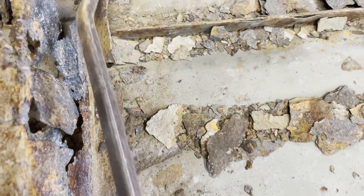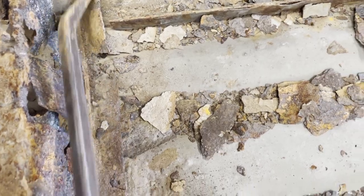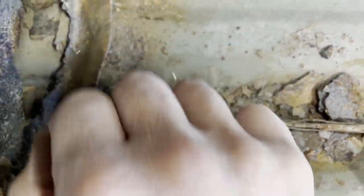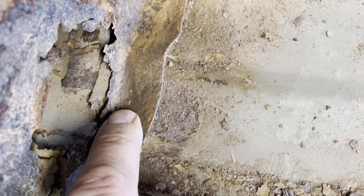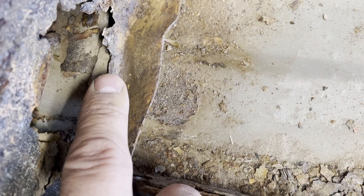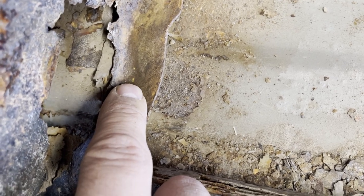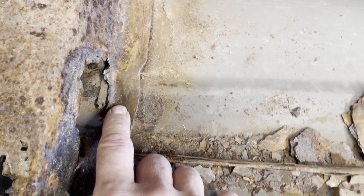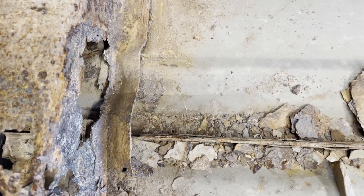This works as a really good tool — it kind of usually starts hitting right over top of it. You can almost see an impression of the circle right there, and that's where the spot weld is. That's what I do to find these when you really can't see them. So now I'll drill a pilot hole and drill it out.